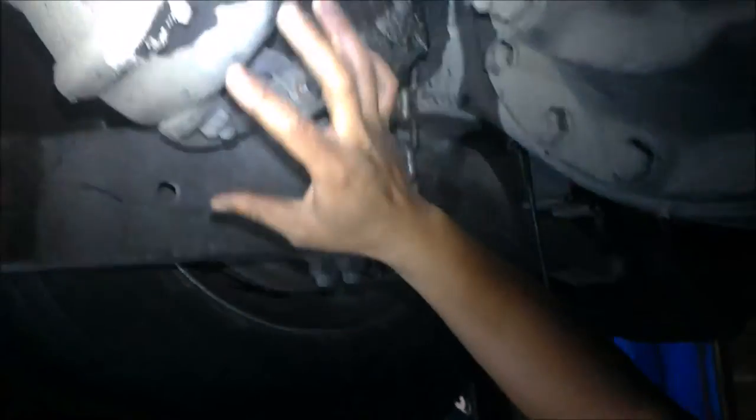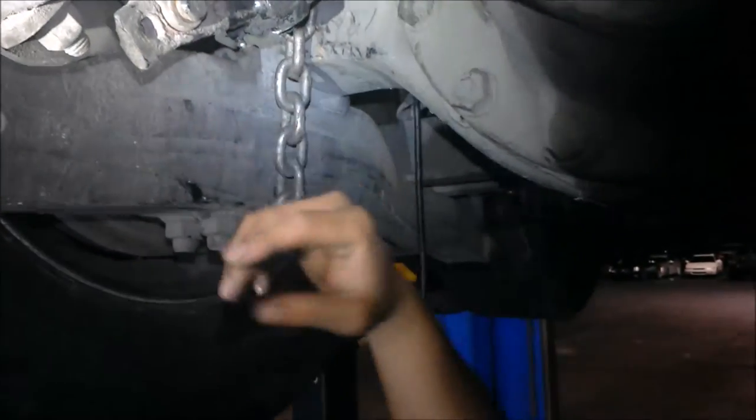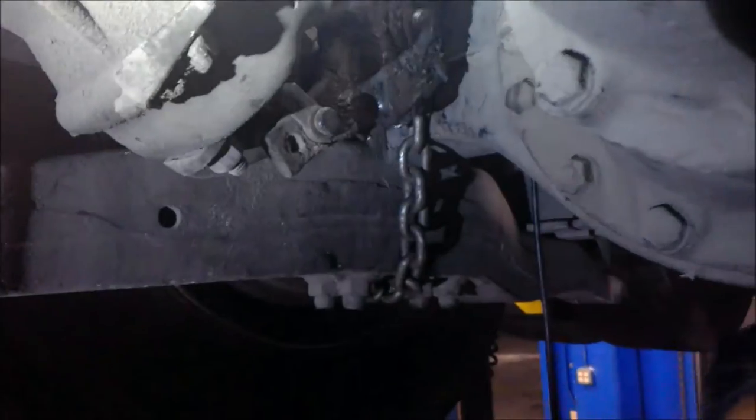Also with the brake, you want to inspect and grease up the slack adjusters. Just make sure that you don't hear any noticeable air leaks between your lines. And thank you for watching my video. That's it.